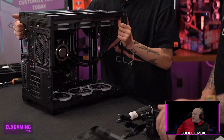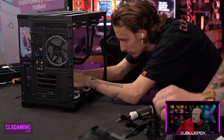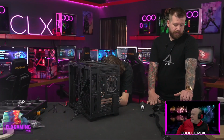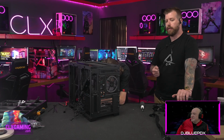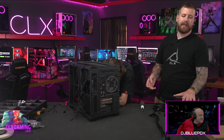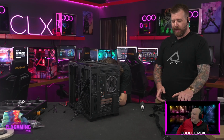Official purple guy says, what's the safest way to clean a PC? And also, what's the safest way to switch a graphics card? I heard that if you do it incorrectly, you can fry the PC. Yeah, so the safest way to clean your PC is obviously to just pull the side panel off and use those blowing cans of air duster. That prevents you from having to get in there and touch any of the components yourself. There are plenty of anti-static vacuums and blower options that you can use if you're really worried about it.